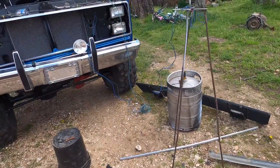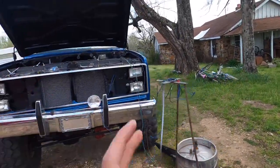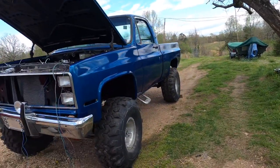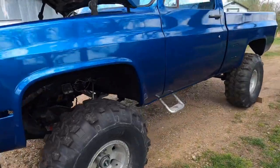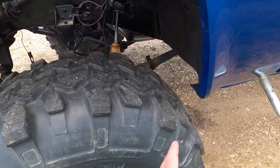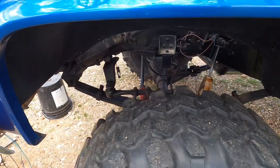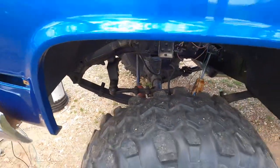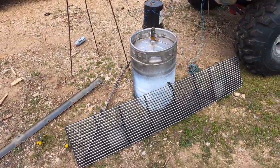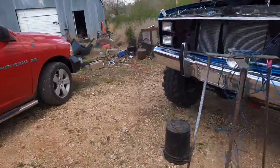The truck's now out of the field. You can see there's a mess of wires — I'm gonna do the front wires in a minute. I figured out the fuel delivery situation, it was just completely out of gas. I also figured out why the front wheels rub on this side — the front end is about an inch, inch and a half closer on this side than the other. The axle's kind of angled because when they bolted it in they just didn't care, but I will fix that. The phantom grille's right there — I know a lot of people don't like them but I'm going to use it because I don't want to sink a lot more money into this.